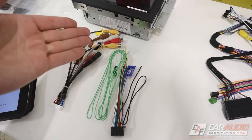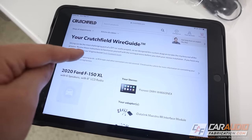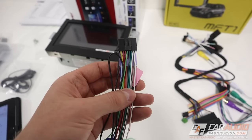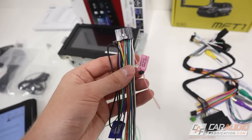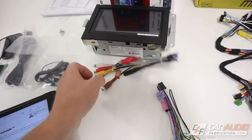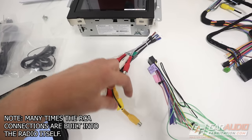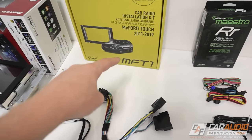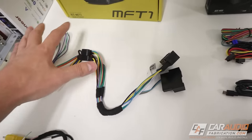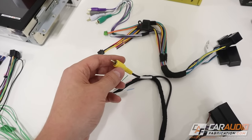I know all of these different wires and plugs can look pretty intimidating, but I'm going to break it down with the help of the Crutchfield wire guide. For the head unit we need the main harnesses — speaker wire colors are usually purple, green, white, and gray; power is red and yellow; ground is black. We'll also need RCA connections if connecting external amplifiers, and a harness that has the reverse camera input. From the MFT1 kit we need the main harness with speaker wire connectors, plus a harness that provides the video signal for the reverse camera.